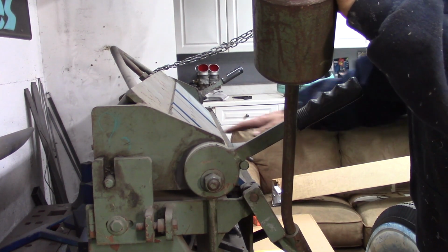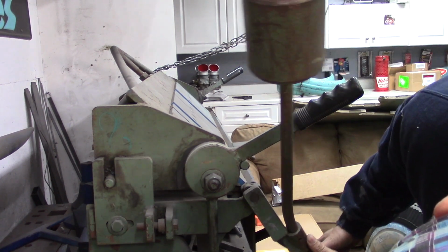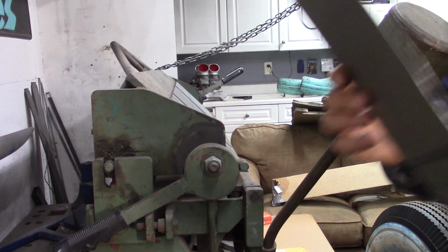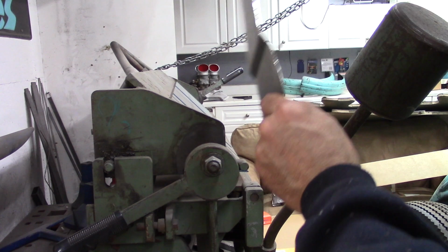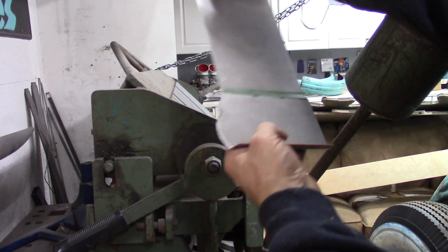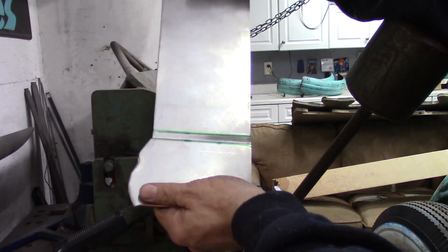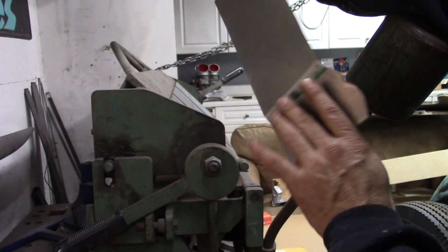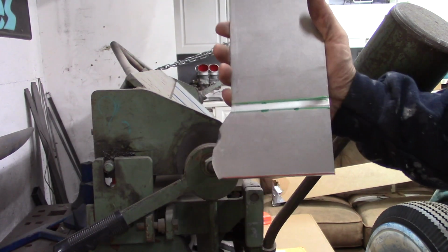So this should be level at the angle I want. So there we have it. That's what I was trying to attempt. This is where the latch pocket is for the hood latch and the spring mechanism, so it's going to go up and go around it. That should have shrunken this down some. So I'm expecting this thing to fit pretty good, minus some fine tuning details on the edges where the old metal was cut out, and this one has to go in.